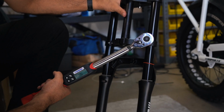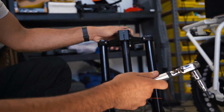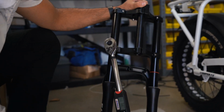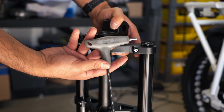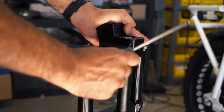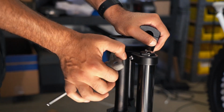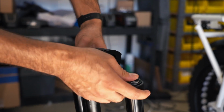Phase 2. Installation of the suspension fork. Ensure the 3 screws at the lower plate of the suspension fork are tight. Tighten these to a torque of 13 foot-pounds using a 5mm attachment on the torque wrench. Using a 5mm Allen wrench, loosen the screws at each stanchion clamp and the 2 screws at the steer tube clamp of the top crown and pull the top crown away from the suspension fork. Some force may be necessary.